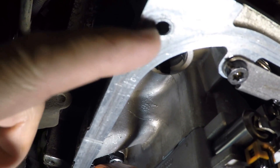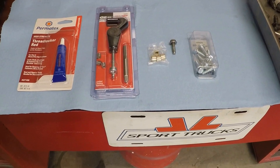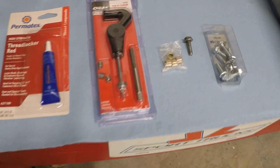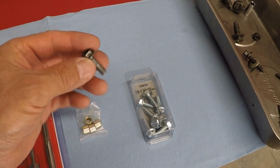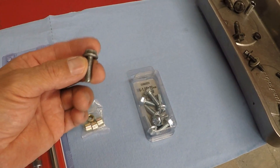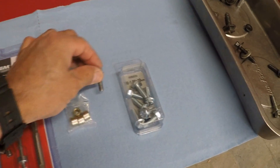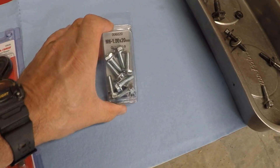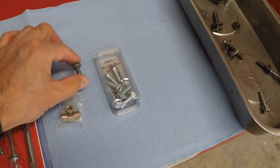So we're just gonna put helicoils on three and we're gonna make all of them this size when we insert the helicoils. These are the supplies that are gonna be needed to repair the stripped threads on the transmission. This was the original bolt — it was the only one still correct and not cross-threaded or stripped — and the size of it is M6 by 1. So I bought all new ones and I'm gonna replace that one too.